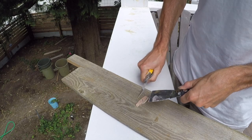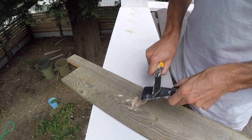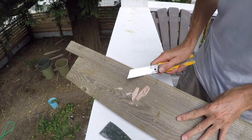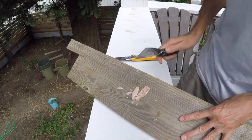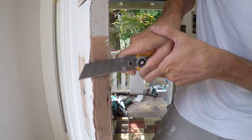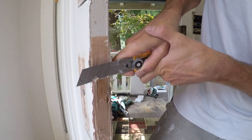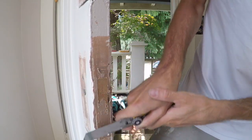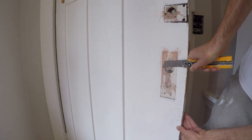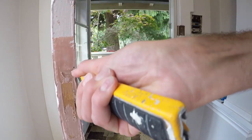You want to keep your tools clean. What I've got here is my long knife and I just shave off the stuff as it's setting up off my blade, because right at this point you can't really sand it without gumming up your sandpaper. I shave it off and then clean the knife blade by running it over a piece of wood. Don't waste time cleaning though — there's a magic state of Bondo where it's just kicking off and it's plasticky, so you can shave it down with a knife. It's really important because you want to get back to this stuff and shave it down while it's in this plasticky moldable state, because in about five more minutes it's going to be hard as a rock. You can see I'm able to knock off all the bulges with my knife right now — this is why you want that long sharp blade.